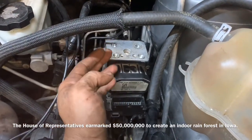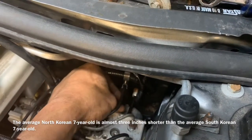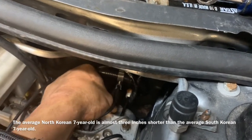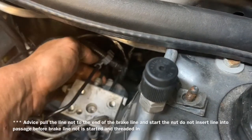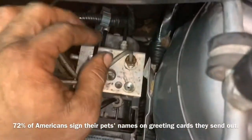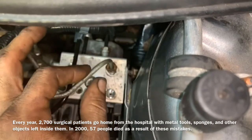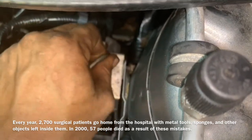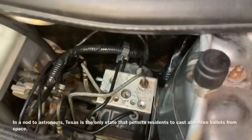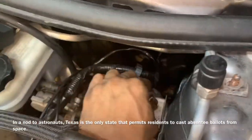Make sure that you raise your brake lines out of the way as you're installing your pump. Your brake lines will turn in as easy as they turned out — if they do not, they are cross-threaded and you need to start over. When you go to start the lines, make sure the line is perfectly straight. You do not want to bend the line itself; you just want to be able to move the line freely and then get it to start. If it goes in as easy as it came out, that's how you know you got it started correctly and it's not cross-threading. If you do cross-thread it, don't put the wrench on it.